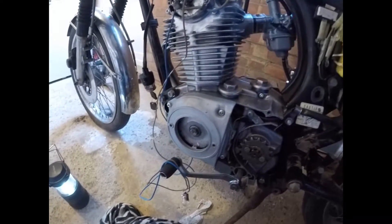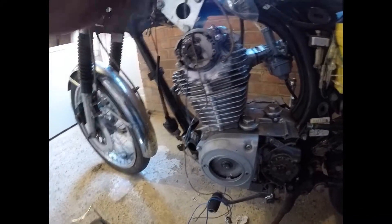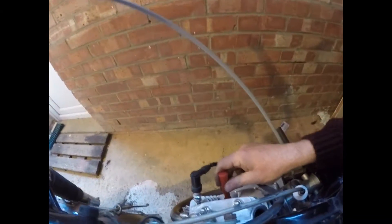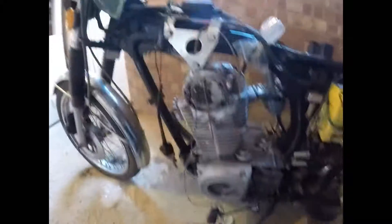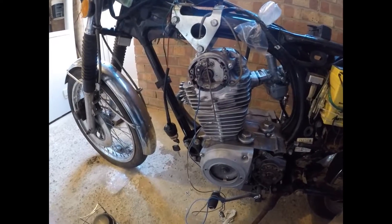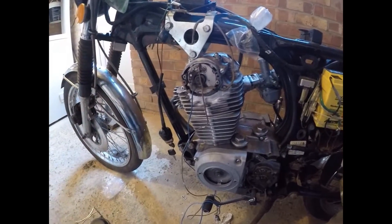Thanks very much. Remember that while you're doing that, it's got to be top dead centre, which just means you're looking at your piston there — you can just feel the piston. It's going to rattle so you know that you're at the combustion point. You can get it with these bikes that the crank is 180 degrees out, and maybe I'll show you in a different video how to get around that — you've got to go in there, get the crank, turn it around. But that's a different video.